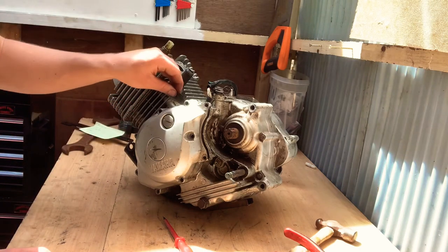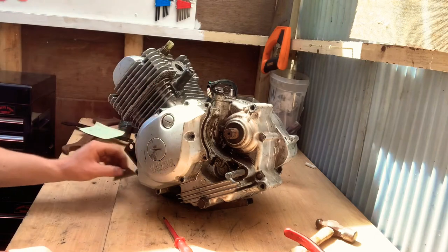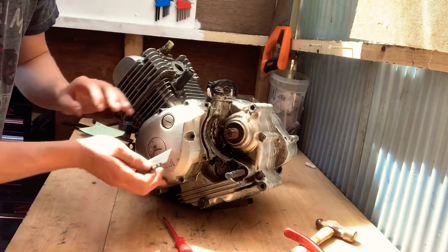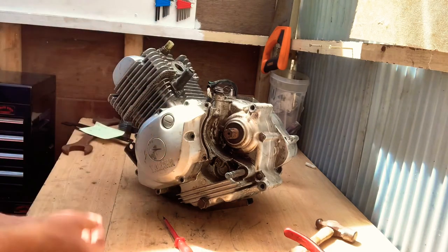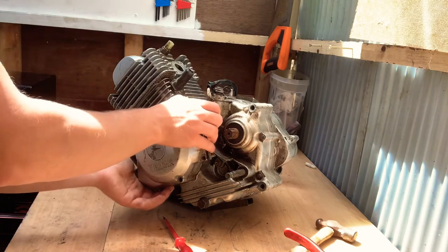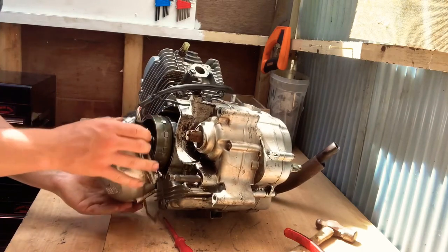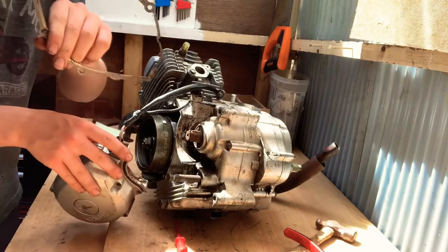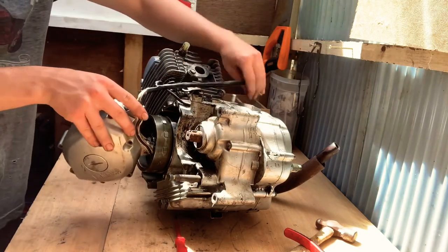So you've got to be careful — try and get it in a position where it's stable. Then go through with your razor blade and make sure the gasket stays on one side, whether it's the engine block side or the casing side. It doesn't matter — this is your magneto casing. Then after you've done that, you need to grab it firmly with both hands and get a nice firm pull and wiggle. Because if you try and do it too gently, it will not come. There's my gasket in one piece — I'm going to put that to one side. Just make sure your wires are all free.